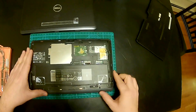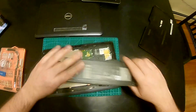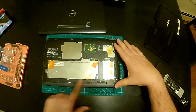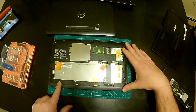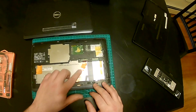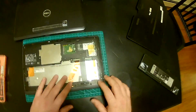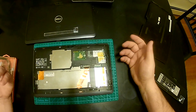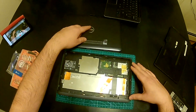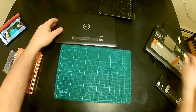Basically, I'm just gonna take the battery out first from this one. Also I want to say this one is messed up as well. There is a circuit board down here that was damaged — liquid damaged — and then everything kind of corroded and killed the computer itself. So what I did, I just unplugged all of these connections, as you can see, going down here, and that kind of enables it to run most of the time. It kind of works, not perfectly, but kind of works. So I'm just gonna try to take the M.2 drive from this one to this one and see if it's gonna work.